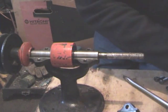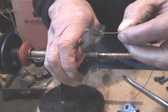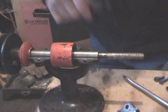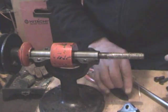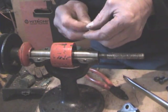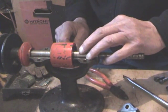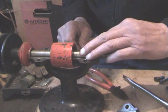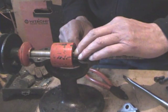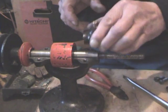While we're doing it, I thought I'd just show you how to check bearings. You just get a small piece of solder like that. And because that's got a groove in, I'm going to put it on the inside edge. You just rest it on there, on your shaft, on your bearing like that. We'll move it to the end. Then you just get your cap and put the cap on and tighten it down.